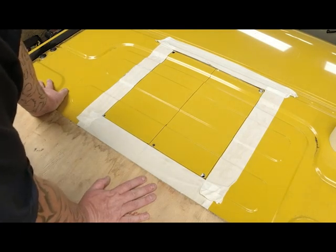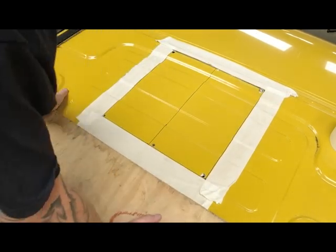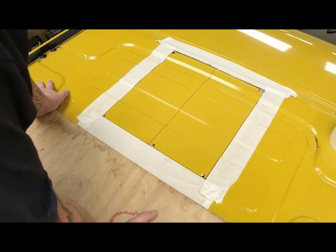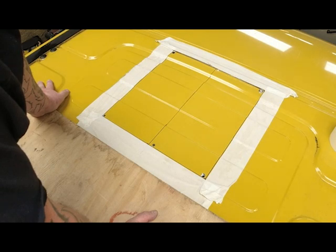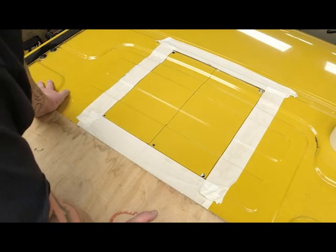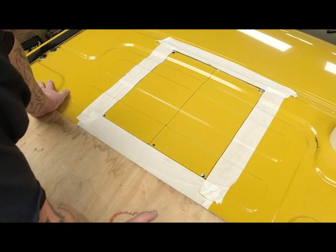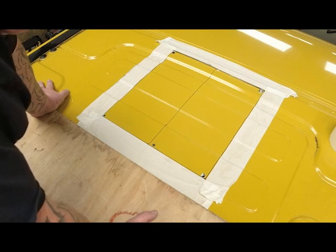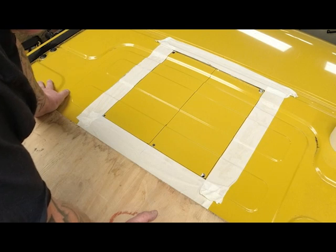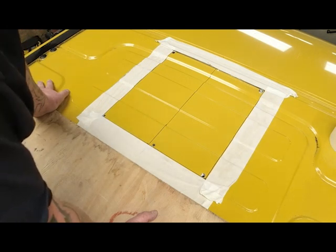What I would say is, once you put your roof vents in and they're stuck down and you're happy with them, leave them a few days to settle in and any sealant to dry, then give your roof a wash off. And trust me, it's worth it. We blow it off here, we'll clean it off as much as we can, but you don't want any of it hanging around. So my suggestion would be, after a few days, wash the top of your roof and make that a job to do in a day. If you have to wash your whole roof off, it saves you having that problem, believe me.